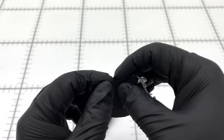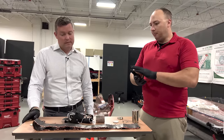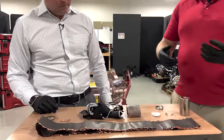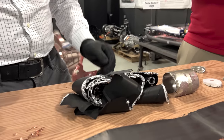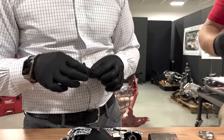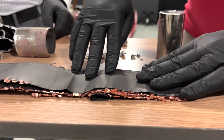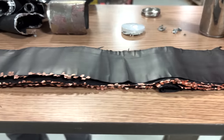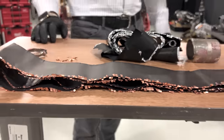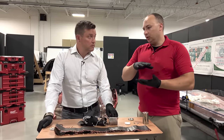The cathode material is pretty brittle — it's an NMC compound, so it's a metal oxide pressed together, usually with some type of binder, and that's bonded to an aluminum film. If it's a dry process, it gets rid of the binding step or solvent binder and uses a fibrillated fluorocarbon as a material to hold everything together, which is more what the anode looks like. The anode is graphite and it's staying together well — it's bonded to the copper strip. The copper strip is about 0.2–0.17 mm in thickness, and that still includes a layer of copper, two layers of graphite, a layer of aluminum, and two layers of cathode material.